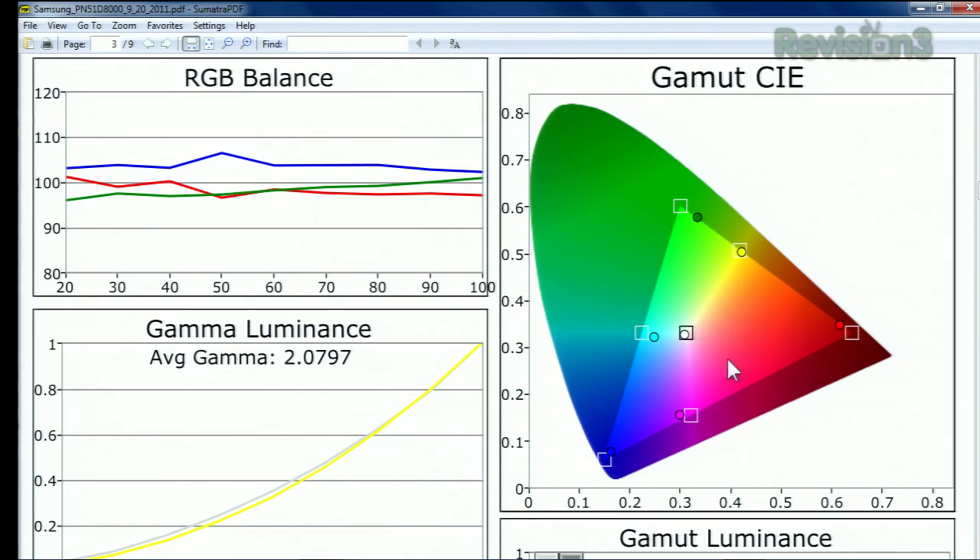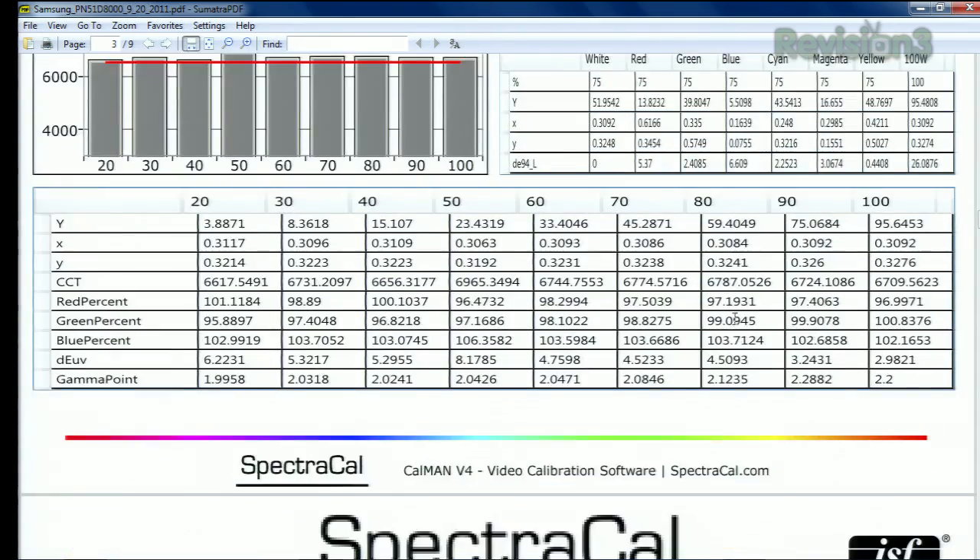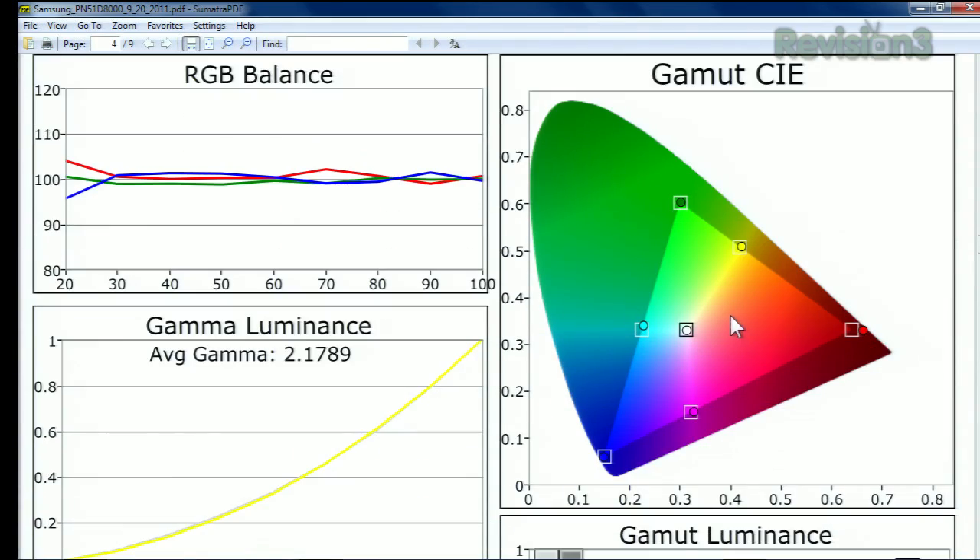The default custom configuration was a little off — actually a little concerning. I'm sorry I didn't take a measurement of the movie mode itself; the default movie mode was slightly better, but both were a little off. However, just to show what can happen: using the basic tools I got the grayscale to balance closer to 100%. With the CIE color control, I was able to dial in almost all of them except for red, which remained pretty oversaturated — a pretty strong red overall. But otherwise, this is a phenomenal result.